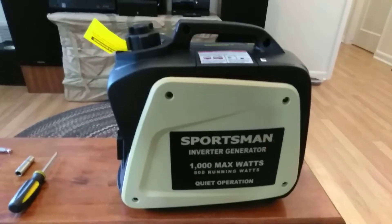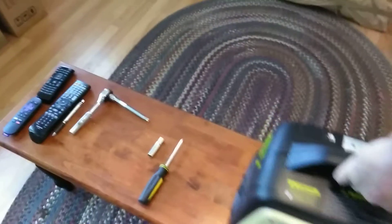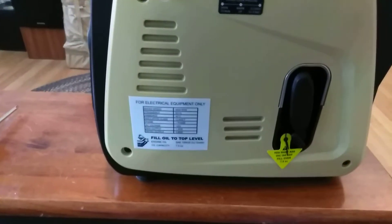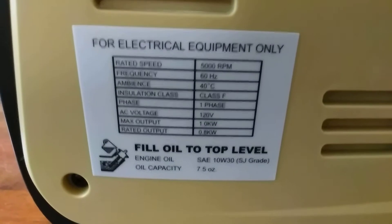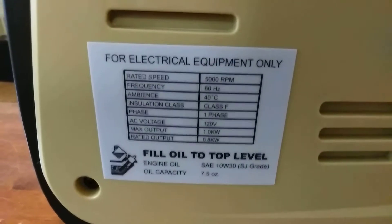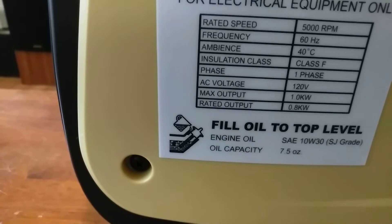The only two tools I've needed so far are a standard Phillips and a 10 millimeter socket. This is the one cover — I'm going to flip it around to show the other side. This is brand new out of the box. I know there were a couple videos about people not knowing how much oil to put in it. Mine says 7.5 ounces. I think 10 ounces was a bit extreme, and even where it says to fill it to doesn't say all the way up to the top of the threads anymore — it says basically to the full mark on the dipstick. So 7.5 ounces. This thing's brand new — I haven't put any oil in it yet.